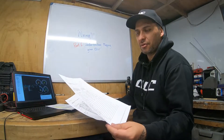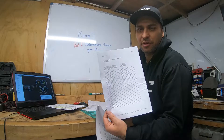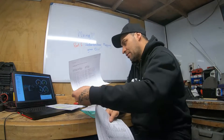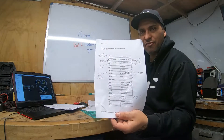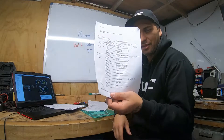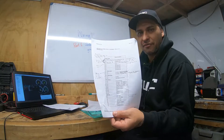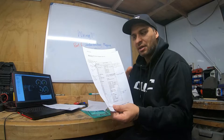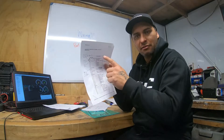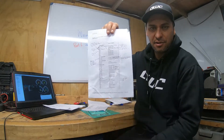Understanding your wiring pinout diagrams and how to find your pins for each input or output — that's definitely handy. Also, save a copy of your ECU file before you start touching stuff, like I should have done. Save the file from when your car was last running, so you know what your original settings were before you go changing anything. I didn't do that, so I had to revert back to the factory settings from this paper here.